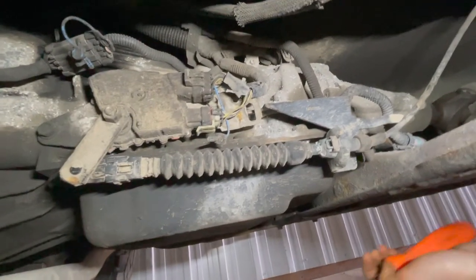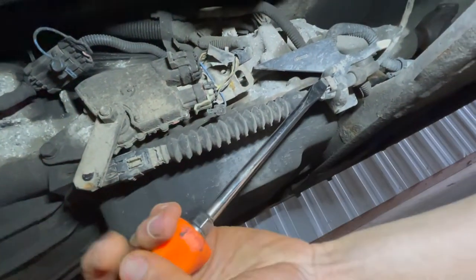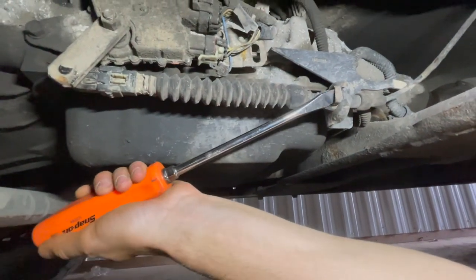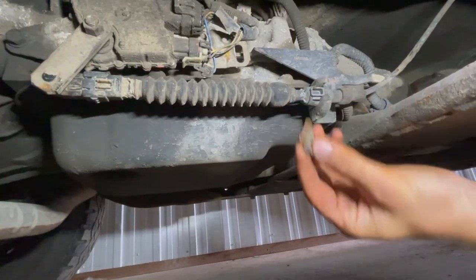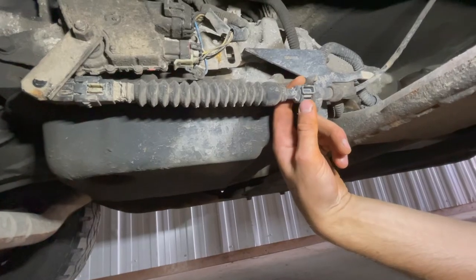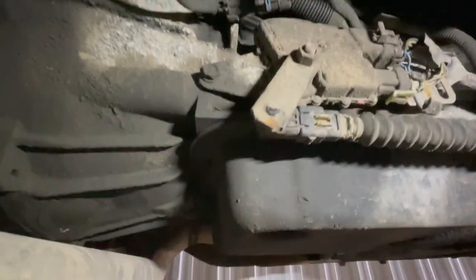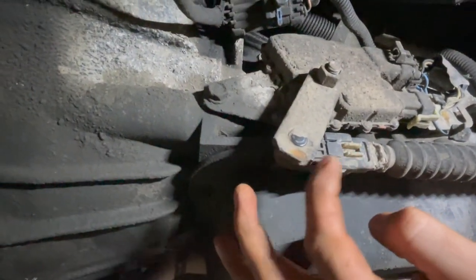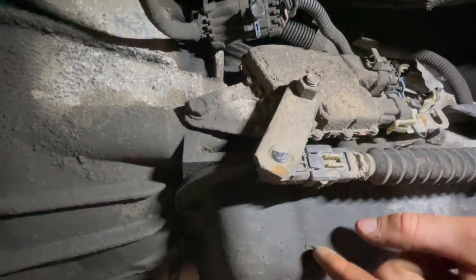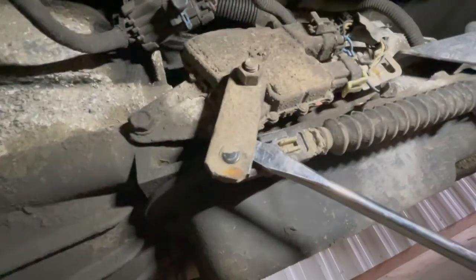Looking at this shifter cable again, we have one of these locking tabs - very similar to the piece that was on underneath the collar. So take your screwdriver and remove that. The next part will be to take your needle nose pliers and compress these two tabs so you can pull the cable through the back, just like under the steering column. Up front, this is your inhibitor switch and this is the shifter mechanism - kind of like a pivot point. So this has popped on. I was mentioning this new part with all these gizmos - what I'm going to do is replicate where it's adjusted on the old one. First you want to take your flathead and get in there and pry it off because it's going to pop off.